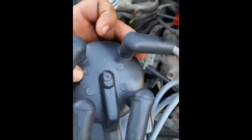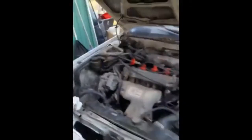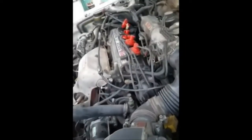Once the last spark plug is done, we're going to switch gears and remove the old distributor cap. This cap is numbered - see, one, two, three, and four. That's the timing I was telling you about. The wires are already on there in the correct order, so when I take off the old one I'll just take a glance and figure out what's what. This cap has three screws - the bottom one is going to be a pain to get to.